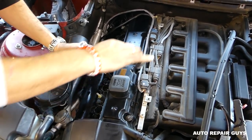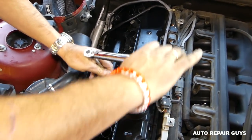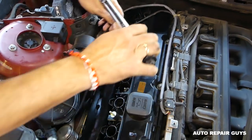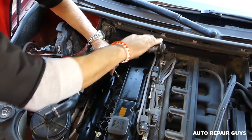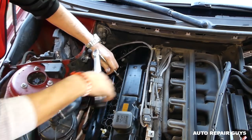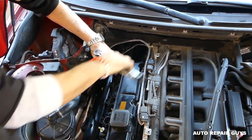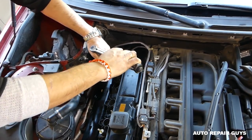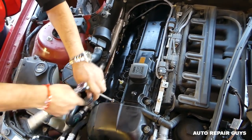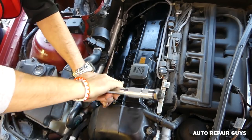Okay guys, we're ready to start. We'll start with the middle ones. Check out now when we start getting them tight. The wrench will indicate that it's ready. Right there. Usually we start with the middle ones, and then we do a cross pattern, starting from the middle, going to the outside. Okay, perfect.